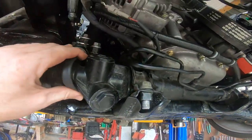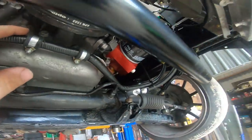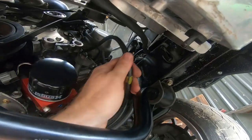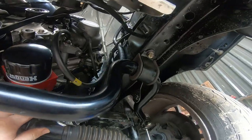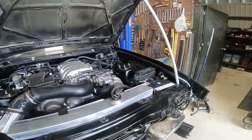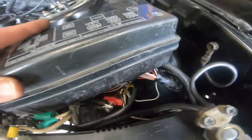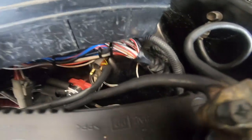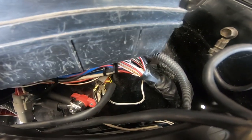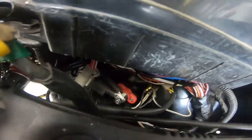The variable power steering solenoid is tucked in — all neat and tidy. I've made the line for the alternator, but I just shoved the old earth back on to get it running, so I'm going to make up a new earth. I've done all the wiring around the bottom of the fuse box. I actually get really upset when people say they've done all this but just need to tidy it up and it still looks like a mess — but this I still just need to tidy up a little bit: a few zip ties, a bit of shrink wrap, a few covers.